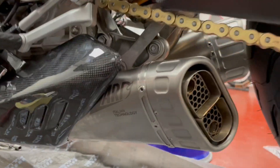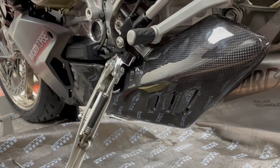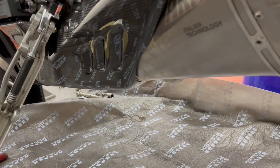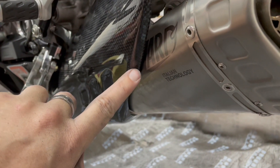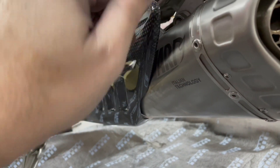This is what I mean about the belly pan and the Zard exhaust. Under here you can see where we've done the cut-out for the lower part of the exhaust — I've shaved off a bit around here, but it's still catching along this corner bit. If we use the side stand, you can see it's catching just here, which is no good. It needs to come around more — I think we'll have to take a bit more along this edge, bring it to that line and up here, and probably take all this off.